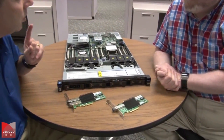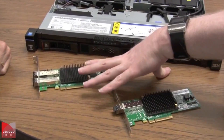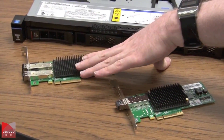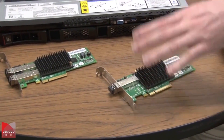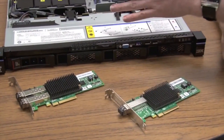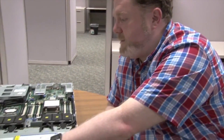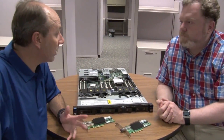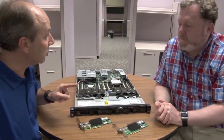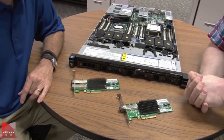And the 16-gig adapter also supports 8-gig fabrics, right? Yes, one of the features of 16-gig, aside from the faster bandwidth, is that with the newer generation ASIC on these cards, it's almost twice as fast even on an 8-gig network. So if you have an 8-gig storage target, but you have a Brocade switch that's 16-gig and our adapter that's 16-gig, you can see almost twice the performance of the previous generation card. So there may be benefits to going to 16-gig even if you don't have a 16-gig storage target yet — there are performance benefits even from just upgrading to the 16-gig card. Yes, absolutely, plus the new features that have just come in.